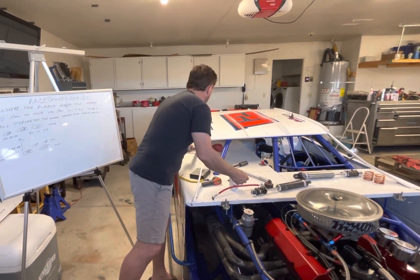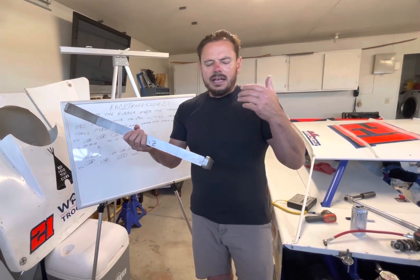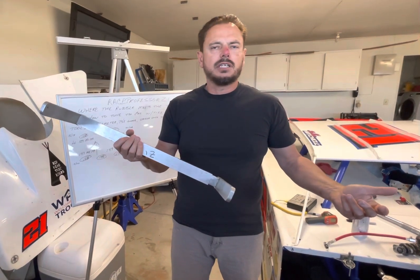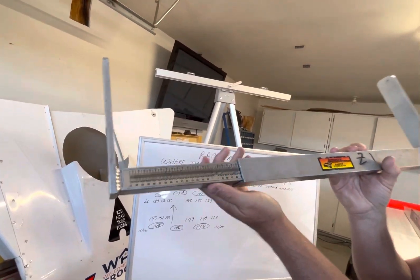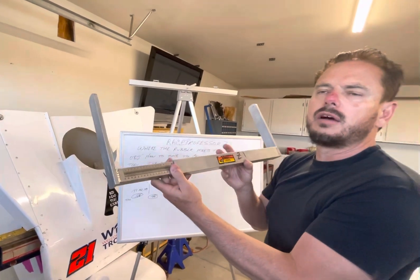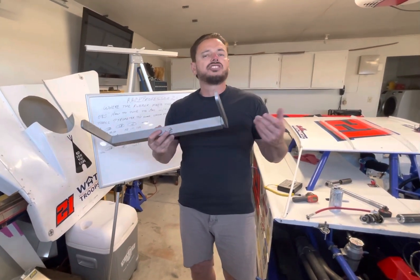Next, you've got a stagger gauge, or what we call a circumference measurement device. You can use a quarter-inch tape, but I don't like that because if you have something on the tire it's not going to give you a good measurement. These tires, when they get hot, you come off the track and they're going to pick up rocks and all kinds of garbage. You'll see the Cup guys scraping all that stuff off before they even do tire temps. What you need is a little stagger stick — it's got a gauge on it. You put it from tire to tire at about spindle height, then read the measurement. Stagger is very important on a race car, especially in the back where if you're going to lock up the rear end, the inside left tire has to be at least a couple inches smaller than the right side, or the car won't turn off the corner.